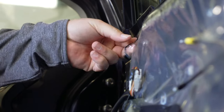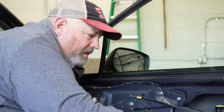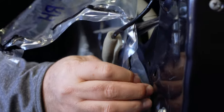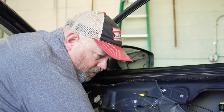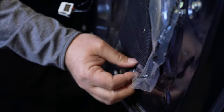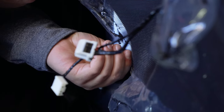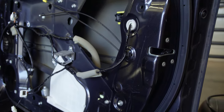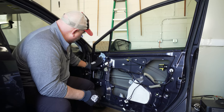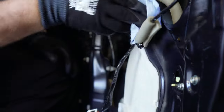There are several ways to get this done. You're going to basically replace the vapor barrier with your Dynomat. If you're lucky enough to get the vapor barrier removed in one piece, you might be able to use that as a template so you'll know exactly what size and shape to cut your Dynomat into. It's also possible to put your Dynomat on the door in smaller pieces and cut them to shape as needed. We're going to use rubbing alcohol to remove any greasy stuff, fingerprints, anything that would keep the Dynomat from sticking to the door really well.